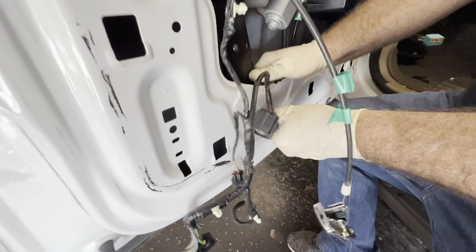We're going to route our harness back into place — that one came around the backside for your speakers. Putting the door handle cable back into place along with the handle. I've got to transfer the crash sensor from the old regulator to the new one. This is a T25 Torx bit — I'll remove these two screws and transfer it over to the new window regulator. Take your time getting the screws caught — they seem to be at least somewhat self-threading.